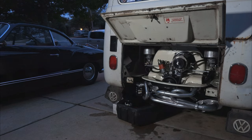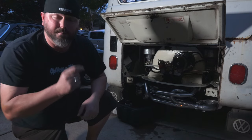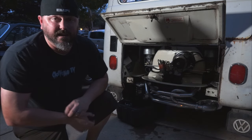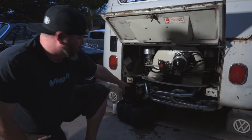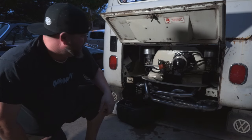I love it! So far, no leaks — fingers crossed. I do have a little leak coming from the cooler, one of the fittings where I put the sensor for the oil temperature gauge. I just need to get under there and tighten that up. It doesn't look like it's leaking out of here, though. I also need to address the fact that the filter is touching the header — this is a much bigger filter, like a coffee can. I need to move that bracket a little bit away so it's not touching the header; I want to give it about three-eighths to half-inch of a gap.